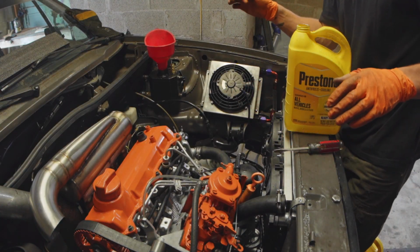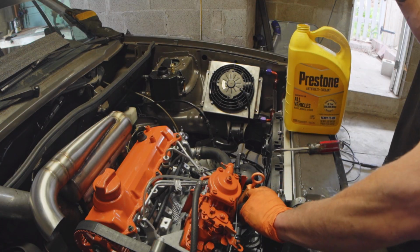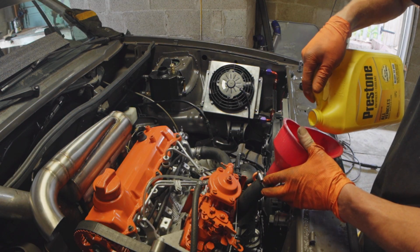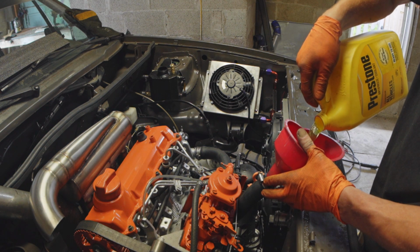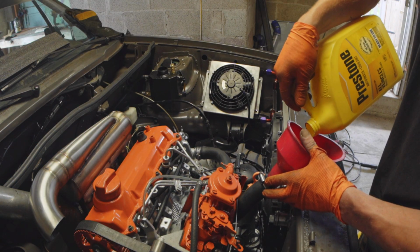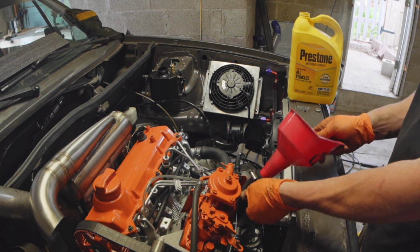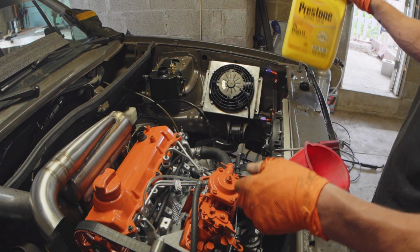And so naturally, if you fill it this way where you're feeding into the water pump, it gets to a point where it stops taking coolant, even though the system is nowhere near full. So, my favorite on these is to just dump it directly into the head, and by this method, it should be full. Yeah, when you start to see the fluid in the pipe and or it starts to spill out your radiator hose. So that was a whole gallon.